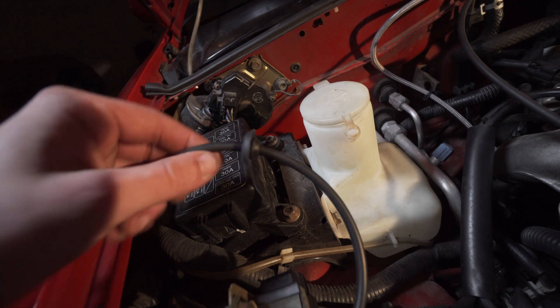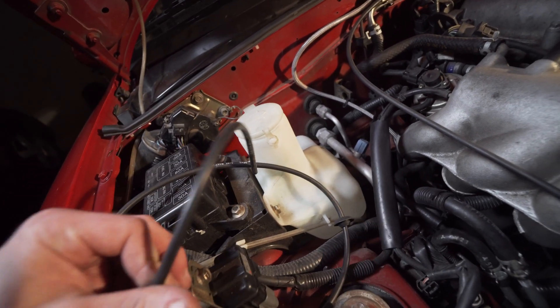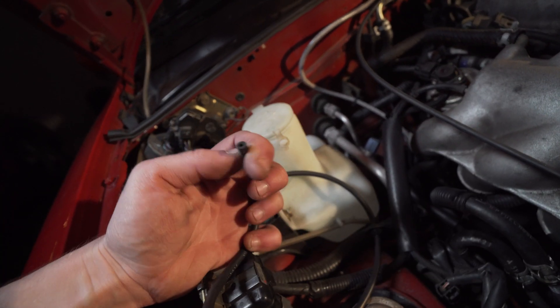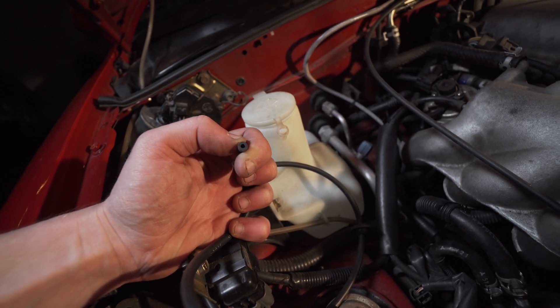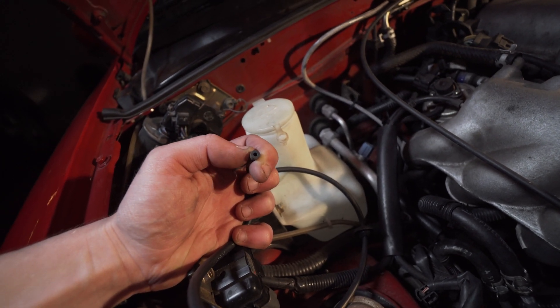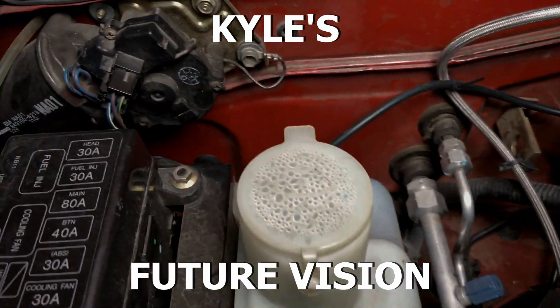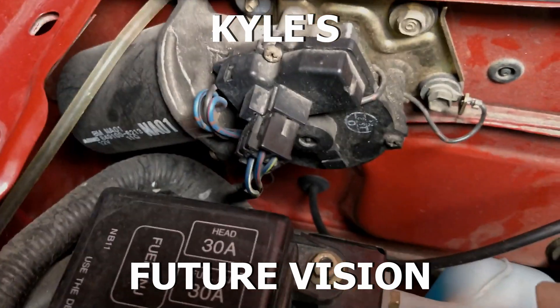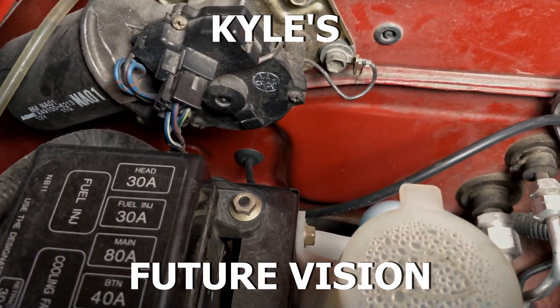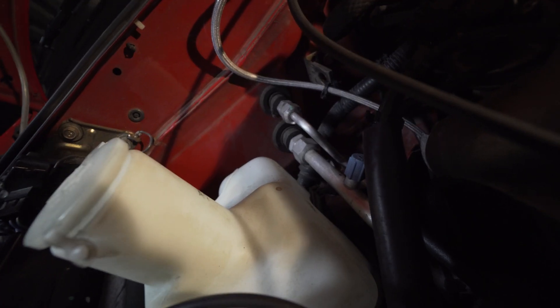So this grommet — I put a quarter-inch hole through it and I've got 7/64th vacuum hose. It's really supposed to be a three millimeter ID hose, which is in between an eighth inch and 7/64ths. That grommet is located right there — for a better angle on the map line, it's that little grommet right back there behind the washer bottle. Hard to miss.